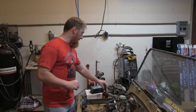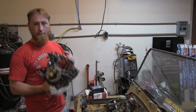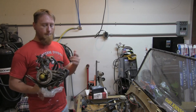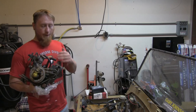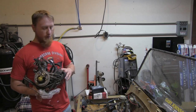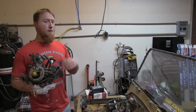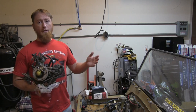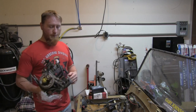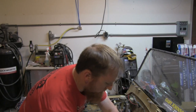So here's what we're going to do. Another reason I'm doing it this way is I picked up a secondhand SPi intake and manifold, so we're going to run that. Part of the reason is I feel this would be pretty easy as far as EFI conversions go, and these ought to be readily available. People are bringing SPi Minis over to the States, and they're pulling the fuel injection off in part because they can't work with the Rover ECU. So these parts ought to be readily available. I picked this one up for about 150 bucks. I don't know if that's a good deal or not, based on what's out there now.